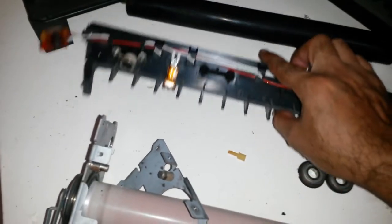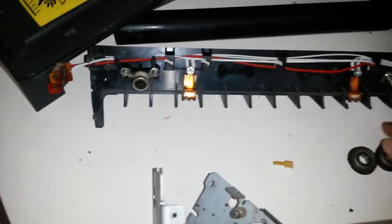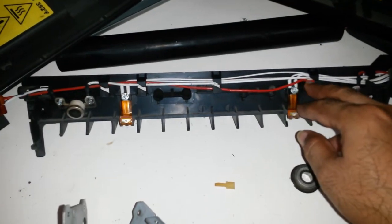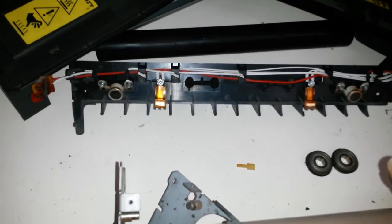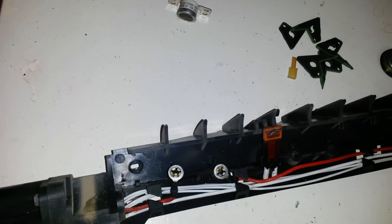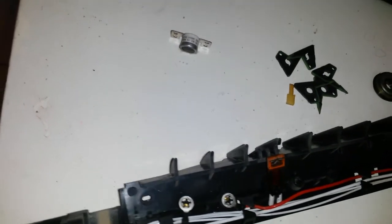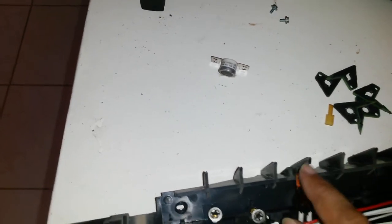This is the plate from on top, with what might be a sensor — we'll figure that out. The wires on this are all relatively substantial, suggesting they carry significant power. The red wire connects from one side to the other, which suggests this is some kind of thermal protection — possibly a thermostat. There are numbers on it to look up. This other component looks like a cap-tip style device at high temperature — possibly a thermistor.